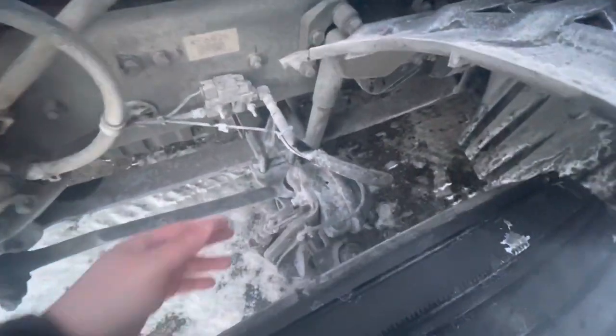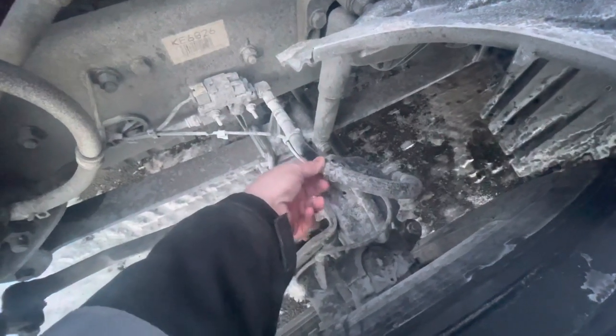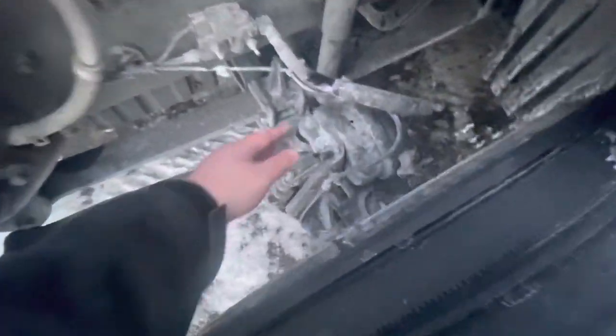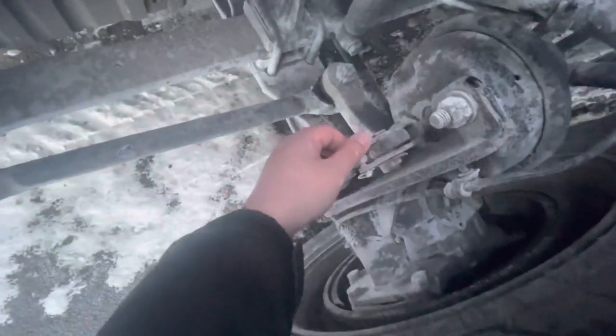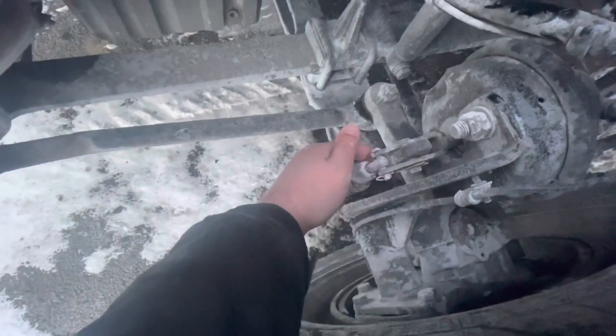Next is my brakes. My brake hose is secured, not damaged, not leaking air. The small wire right here is my ABS, which is secured, not damaged. My brake canister is secured, not damaged, not leaking. Right here is my slack adjuster, and the rod right here is my push rod — both are no more than one inch of free play. Then my brake drum has no cracks, bends, or illegal welds. My brake pad is no less than a quarter inch.